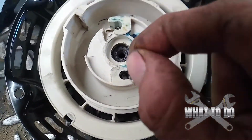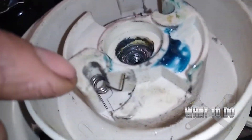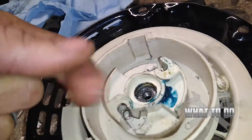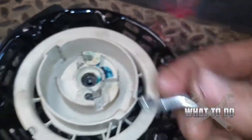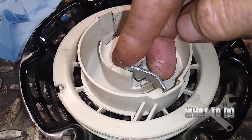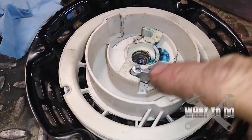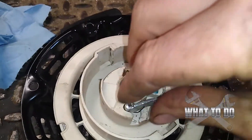Basically, those springs will just pull out of that groove and you set them in. I already have those springs in there — you can see how that spring sets. That part of the spring is pushed against this wall, and then you're going to have this tab which is sticking up on that spring. It's very important that these go in the right way. This is going to slide down in that groove, but it's got to go behind that spring. When this pulls, you can see it's going to retract right into that groove. The reason it goes behind that is so it can push it back into place. You want to make sure that that's tight up against there.